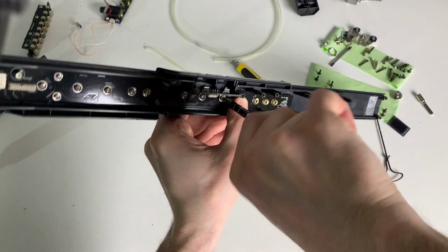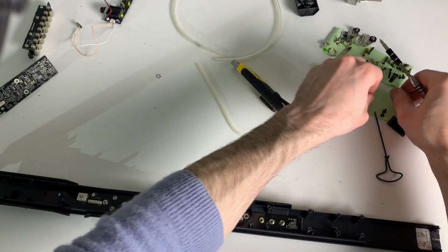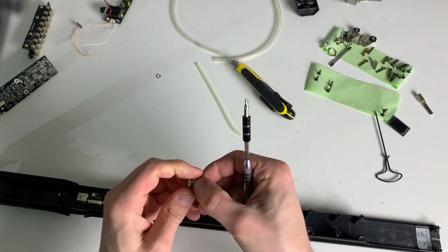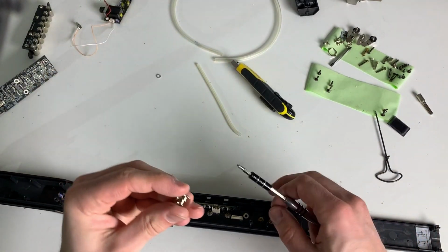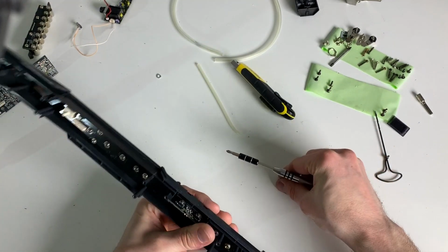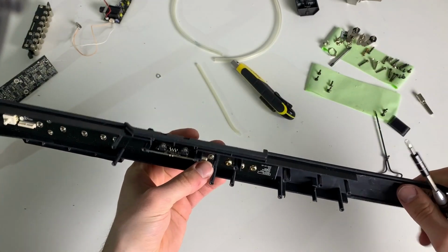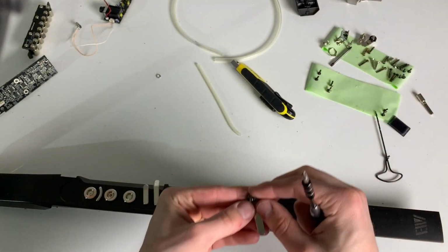I don't know how it got there, but it basically blocked the path of the pressure of the air, and therefore the pressure wasn't released that fast, and the sounds kept latching. So you started a sound and you wanted to stop it. You wanted to stop it and stopped blowing into the instrument, obviously. But the sound still kept on playing. That was quite annoying, because only half of the music is making sounds. The other half of making music is actually being silent when needed.